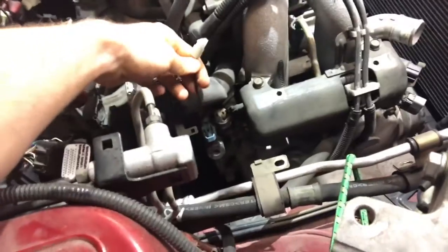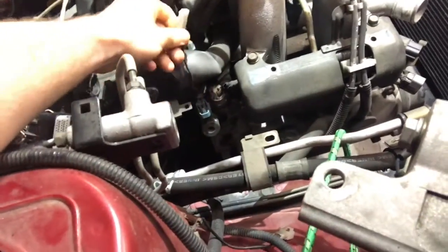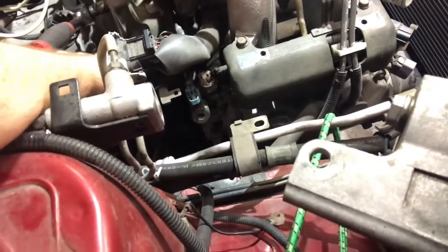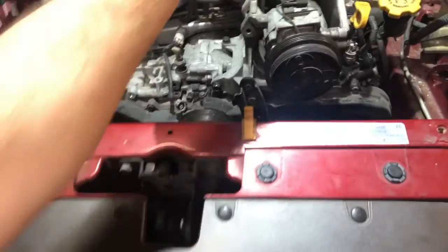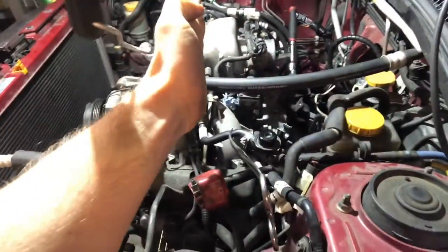Do make note that you've got a lot of these little engine grounding straps. So while you're lifting this thing out, just check all your connections again to make sure you've got everything out of the way. Then you're going to be putting strain on the engine output shaft, so you just want to be really careful to try to get this thing to come out like this and then lift it up so that you're not putting a lot of stress onto the shafts coming out of the engine.